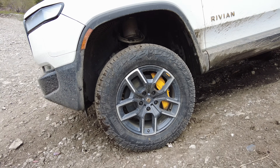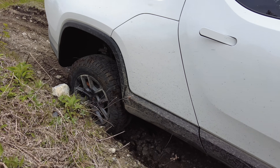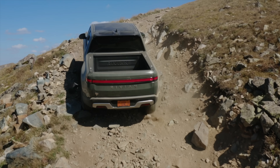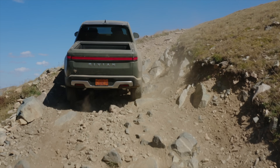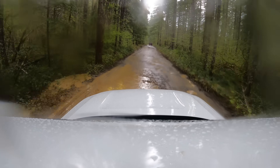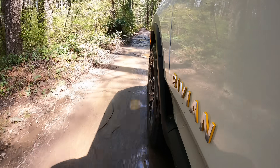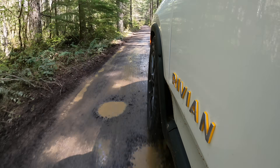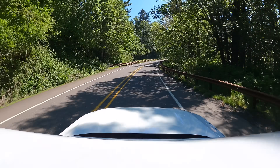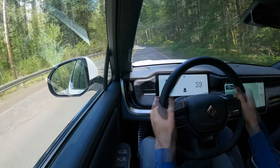The front left is heavily extended, stretching the suspension so the tire maintains contact, and the rear left is heavily compressed. The vast majority of vehicles in this scenario would have at least one, if not two wheels up in the air, highly compromising the all-wheel drive system. But the lack of sway bars and long suspension travel allows for contact, meaning the tires get as much grip as possible to put down torque. Thanks to the lack of sway bars and no solid axles, I've never driven something that so carelessly rode over potholes — it's almost as if they don't exist. The ride quality over potholes in off-road mode is exceptional, without your head being tossed around violently. Then go on-road, and the system enables the cross-connection of the various corners, giving you a really flat, responsive ride. It genuinely transforms the truck for the conditions you drive in.